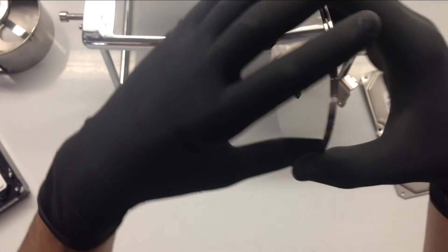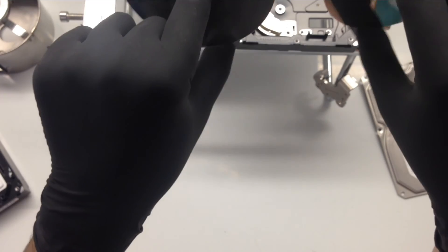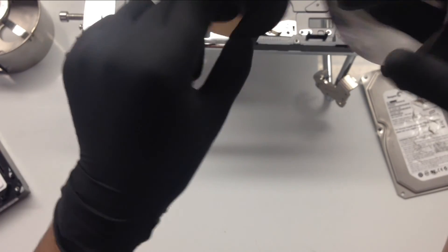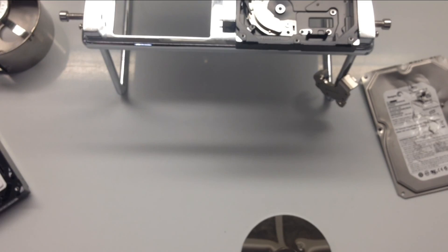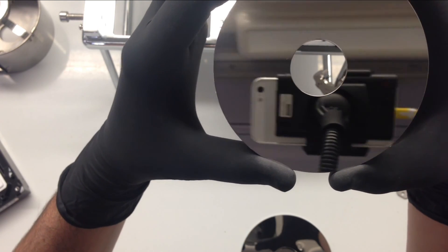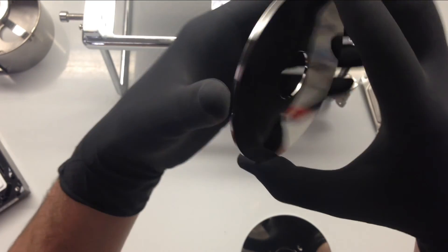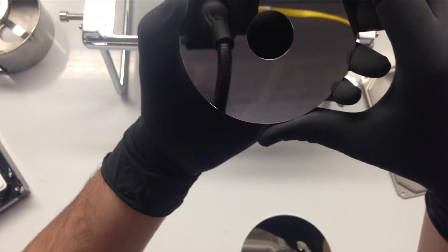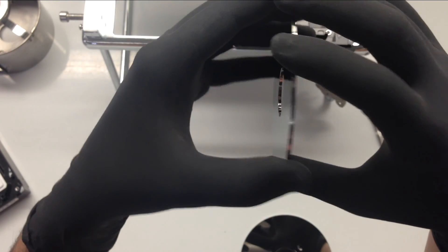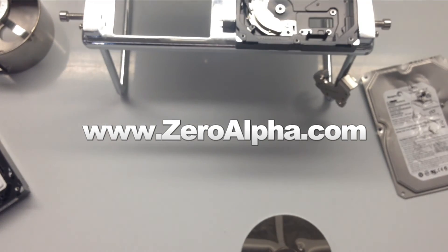There's no chance the heads would have survived — brand new parts would have been destroyed every time. This person has done a good job of protecting their data, though I'd probably like to see a little bit more damage done. Here's a demonstration of what a nice working platter should look like — the surface is nice and flat, nice and shiny, absolutely no damage. Had we seen that, yes, we would have got the data. But the hammer actually destroyed them, so we deem this a failure.